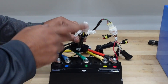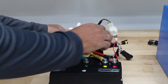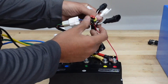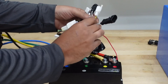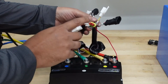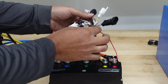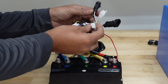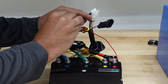Out of the controller there are two wiring harnesses. The one with the three plugs is for the CAN bus — we won't need that for this project. The main wiring harness we're using has labeled connections: one for the throttle, one for the key switch, and one for the brake. For the key switch, if you have an ignition you just make or break the connection; if not, you need to make sure the connection is somehow closed so the motor can work.